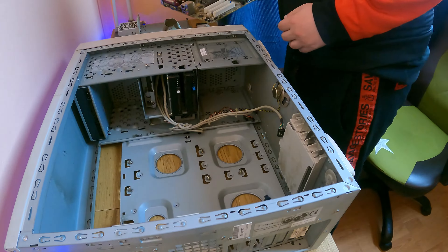I'm going to use just window cleaner to wipe out the dust. When it comes to the CPU, I'm going to wipe out the old thermal compound and apply a fresh layer of thermal grease. As for the graphics card, this FX 5500 does not need any specific maintenance — I'm not going to take the cooler apart and apply new thermal compound because it's not going to help in any way. Just remember that these old graphics cards have managed to stay alive so long because they run really cool and are not going to impose thermal problems.